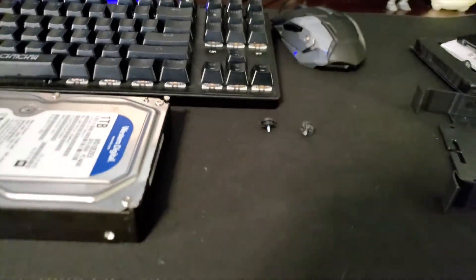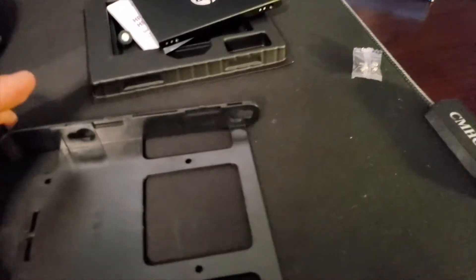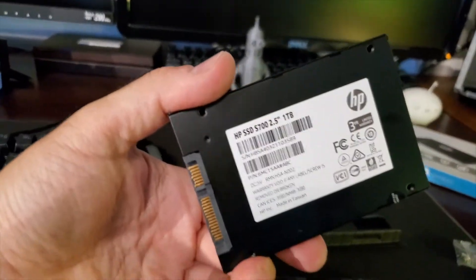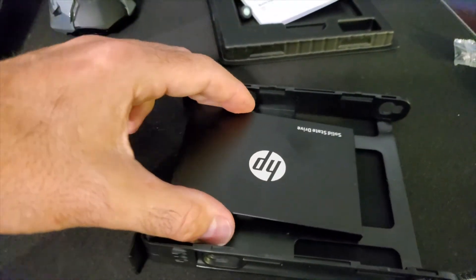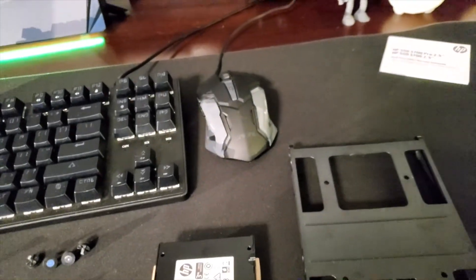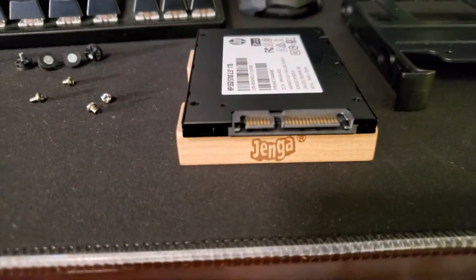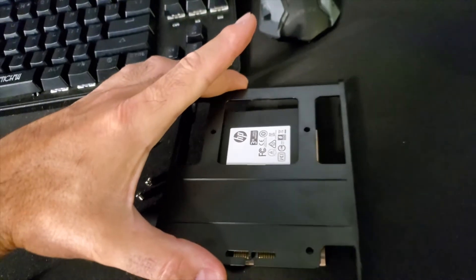You can save these clips. Now, if you see here, here's your board, here's your hard drive. You see the screws on the bottom? They line up perfectly with the screws on the bottom of the board. It's going to go in like that. So we're going to screw this on right now. I'm going to mount the SSD drive to the original board, and I used Jenga to help me because I have to hold it with one hand. So the four screws right here line up with these four screws, and we're going to put them right here like this.